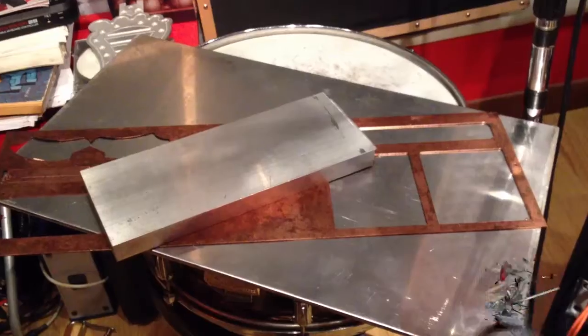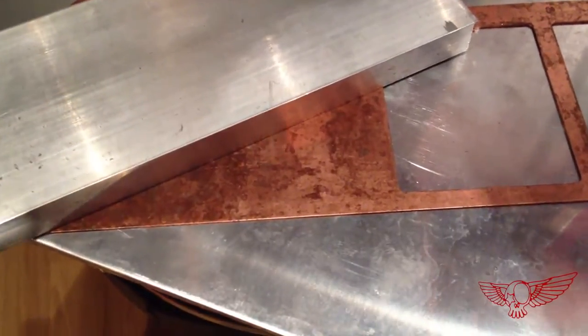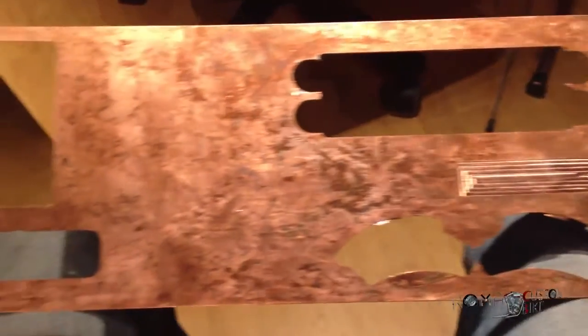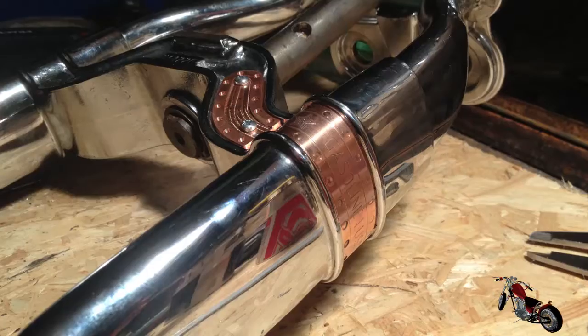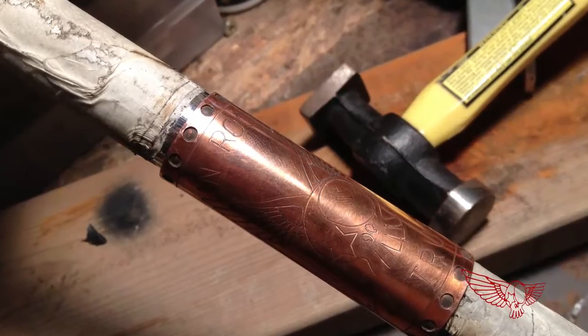This will also give me a chance of demonstrating how to work the stock from two sides. The stock is another very important thing to know before designing. In this case I'll use two: one is a plate of aluminum 5mm thick, and the other one is a copper plate about 1mm thick. As you can see, I've already used this plate to make a few pieces for my Springer fork. We'll work the aluminum from both sides because the bottom part will have to fit the original piece.